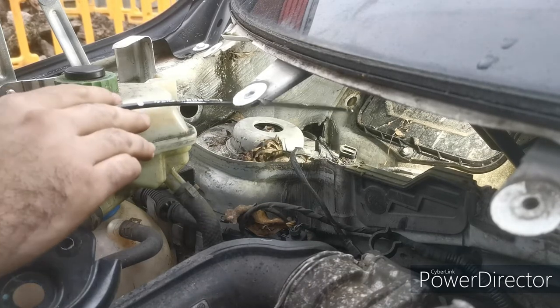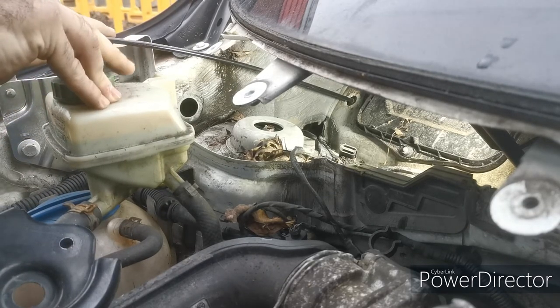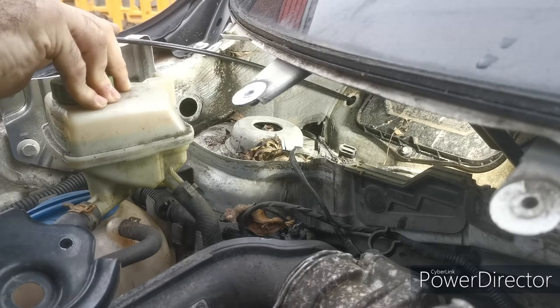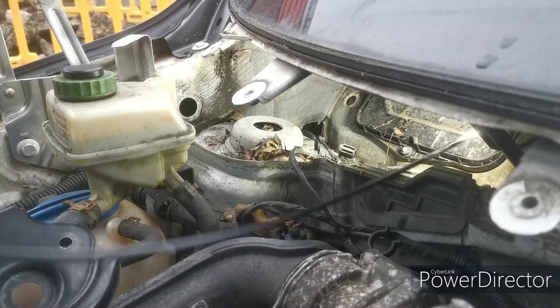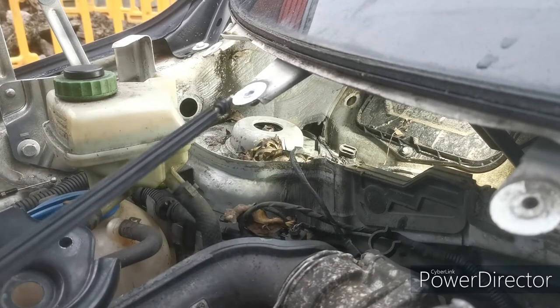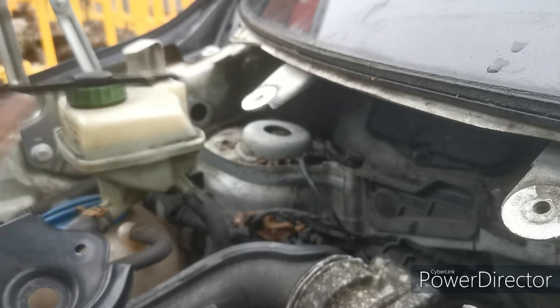You can see this hole down here, I'll just point to it down there. This is where this cable's going to go, and that goes straight through the foam sound deadening inside, straight out into the sort of underneath the dashboard. You can get to it from the footwell, so you don't need to take any of the dashboard out, other than the bits that I've already removed, so the two little side pieces. But that will slide straight down there. And then this end, the opposite end, the bigger end, will go in this hole, and then back down the wing. Actually, what we'll do, this end's going to go into the bulkhead down there, but I'm going to send this straight through the wing. Hopefully I can pull it all the way through.